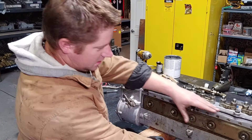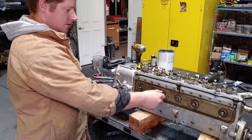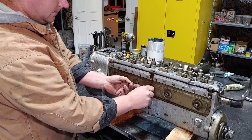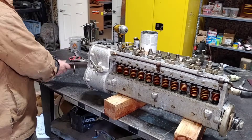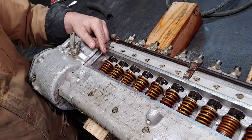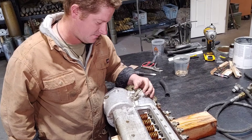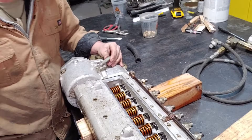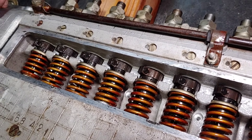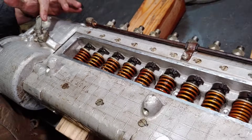This side here — this valley — gets filled completely with diesel. These are all your ports for fuel injection. This here is your accelerator linkage arm. Every time you hit the accelerator, you're opening up these fuel ports, which are in demand for more fuel or less fuel.